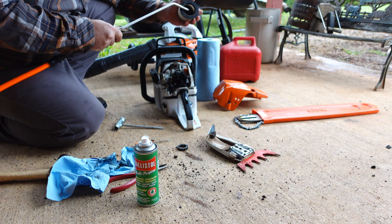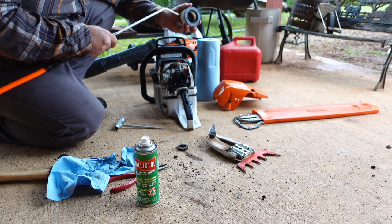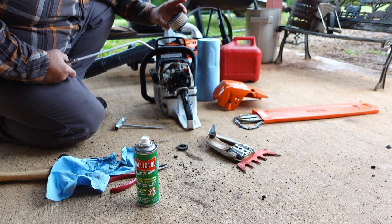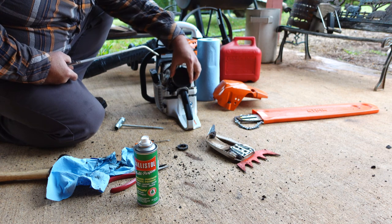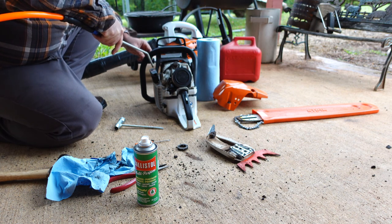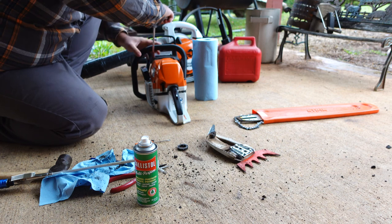Blow out your cover, take your air cleaner off, blow it out. I mean, this is simple maintenance, and you should do it a lot more often than once a year. Put that thing back on there before you go blowing anything else out in the motor compartment. You don't want to be blowing a bunch of debris down inside your motor. And just pop your cover back on.